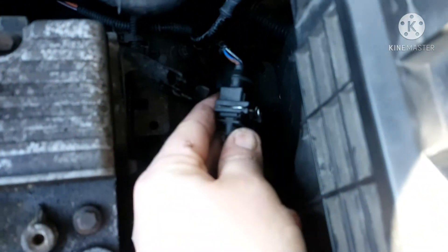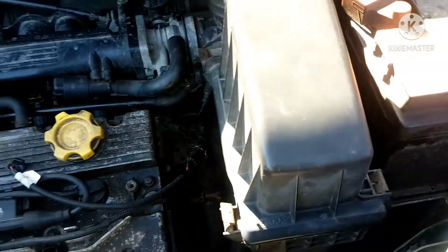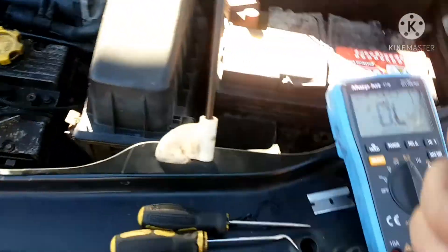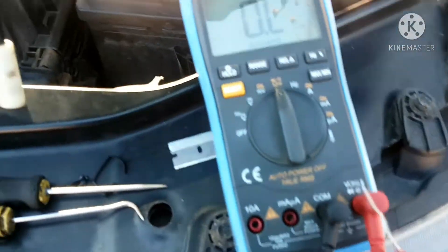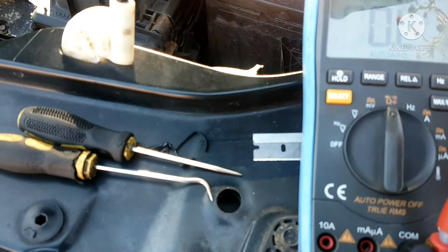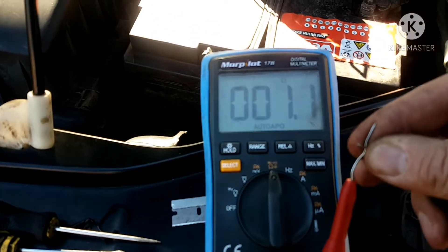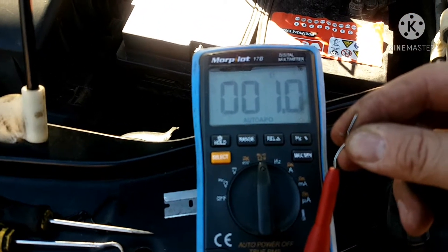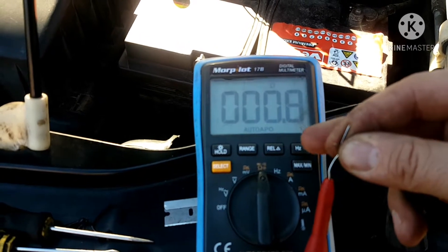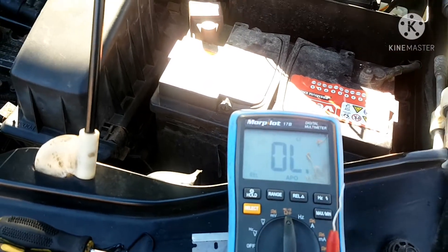If you follow the wire down, there's a plug here. We'll be checking if there's resistance on that. The wire lines up — it's yellow with a purple trace. First thing I do, I've got the little meter set up. If you want to check how much resistance is in the test leads themselves so you don't get a false reading, you touch the probes together and hit this button here — it zeroes it out, takes all that out of the equation.